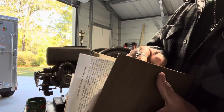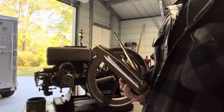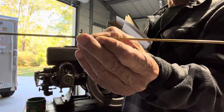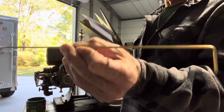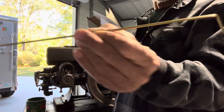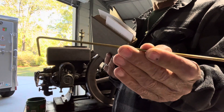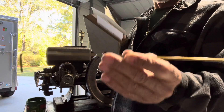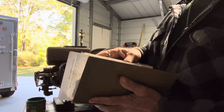In this book he talks about using what they call a tram, and I made one here. It's just a brass rod that you bend at both ends. He states it could be anywhere from 15 to 30 inches long — this one I believe is 30 inches long. I made it longer so I could use it on larger and smaller engines. I'm going to give a demonstration on how he shows in his book how to check the range of operation of your exhaust valve using a tram.